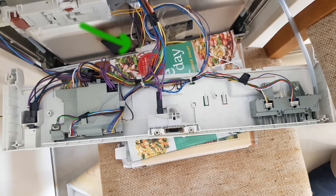If you got a correct reading for the element but earlier got a wrong reading for the wiring, then look down where the green arrow shows on the side of the door. There is a plastic casing that holds all the wires as they go down under the dishwasher door — this is where they'll have broken. This casing is there so that broken wires won't touch the metal of the dishwasher. They'll always break eventually as they flex every time you open the door. If you open this up carefully, you'll find your broken wire most likely in there. You'll need to make a joint near the control panel and another joint down underneath the dishwasher, then feed the wire between the two and join it together at each end.